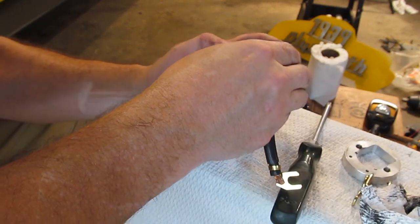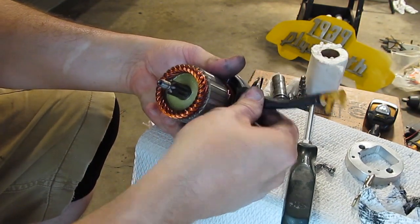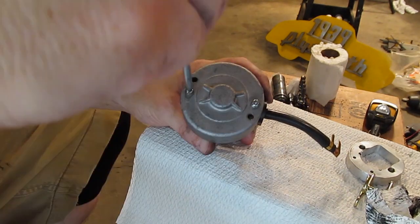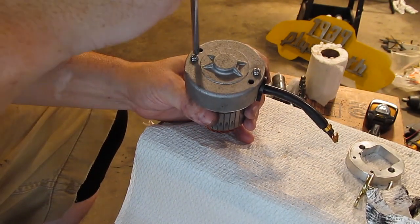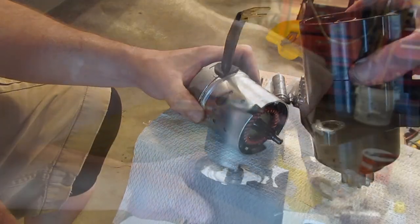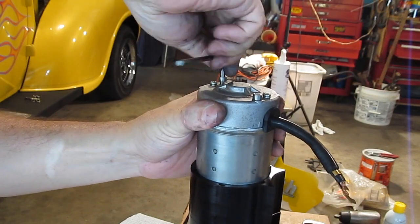Put that on and put your locking washer back on. Basically put the housing back together — this part all went pretty smoothly. The parts were a nice fit; they weren't Harley parts but they were all nice and new. Get that down snug, check and make sure you've got good movement — all feels good. Put it now in the lower housing, and don't forget to put your ball bearing back in the end of that shaft. Use hand tools on this.